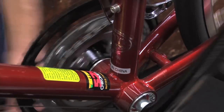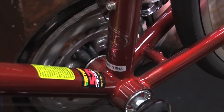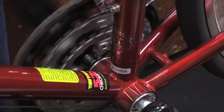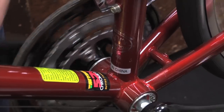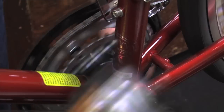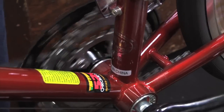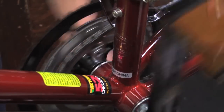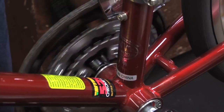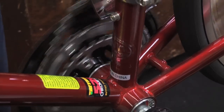We're almost done, but now we have to go back and check the shifting between the middle and small rings, and the middle and big rings. Any adjustments we made in the high gear will also have affected the low gear. You may have to go back and fine tune the position of the derailleur, the cable tension, or the limit screws. Remember, adjusting a front derailleur is the most difficult adjustment to make on a bike — it's a trial and error process, and it takes a good bit of practice and patience to get the hang of it. So give it a try, and we're here to bail you out if you need it. I'm Mike with In-Town Bicycles in Atlanta, thanks for watching.